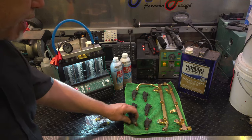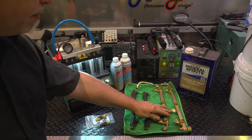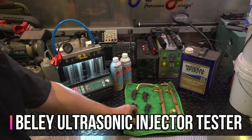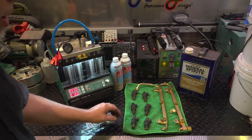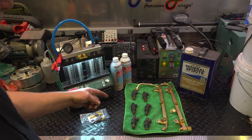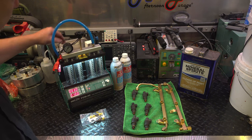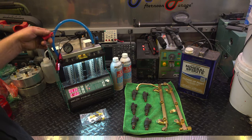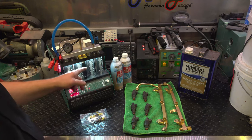All right, time to do something with these nasty injectors. The engine didn't run very well, so I don't expect these things to flow very well. What I did was I refurbished the fuel injector rails, and I'm gonna use a tester like this. I want to get a baseline to see how each one of them sprayed — compare the flow rates between each one of them and look at the spray pattern. There's an ultrasonic cleaner back here with the heater on. We're gonna use Berryman's cleaner in there — you just plug your injectors in and it cycles them.